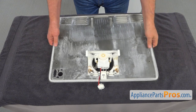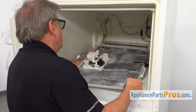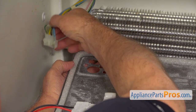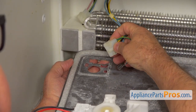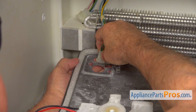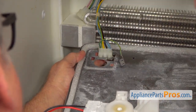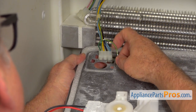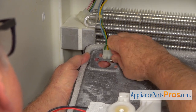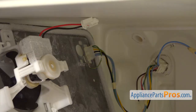Next, let's take it to the fridge. I'm going to bring this cover in and turn it, supporting it with my left hand from the outside. I'm going to grab this plug and insert it, supporting the sheet metal and placing the plug in, then press it through. Next, I'm going to install this ground wire. I'm going to bring the panel up and connect the motor plug.